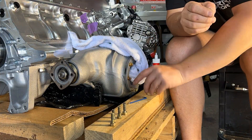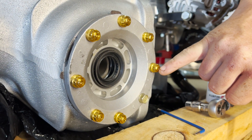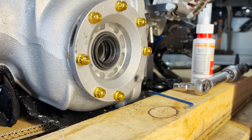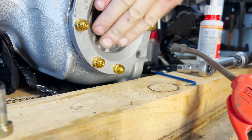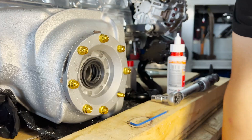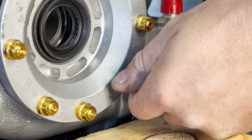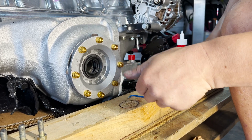I'll show you how I've carried out all the stud removal — just one at a time, very carefully. This is the only stud that requires silicone. For the rest, I remove them one at a time, undo it, clean up any old silicone, give it a blowout, and clean it out. Grab your stud, do it up just till it touches, slide the washer on first, add a little drop on the thread — not too much — then put the nut on. The gold anodise on these titanium studs is next level. I love it. Really good anodising.